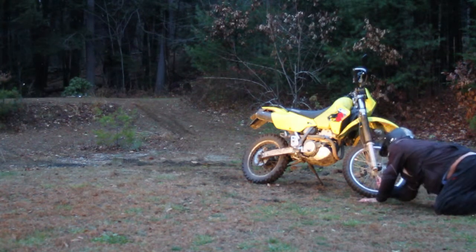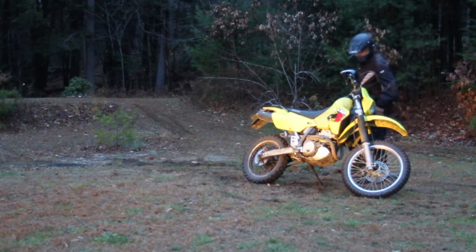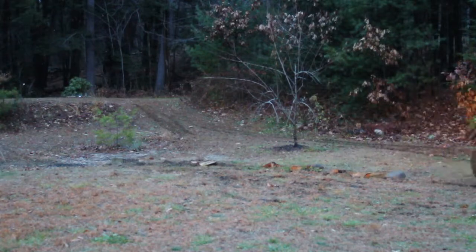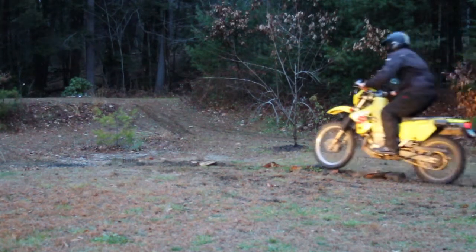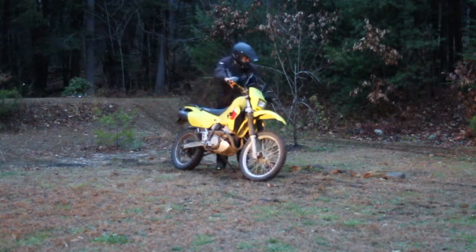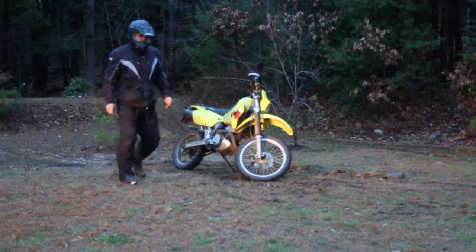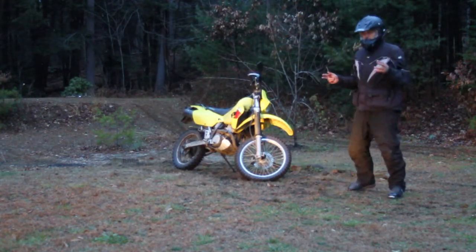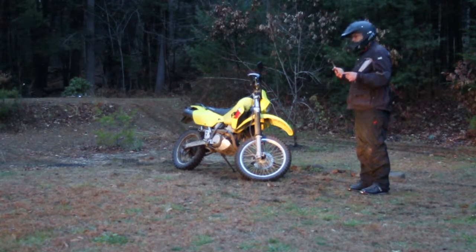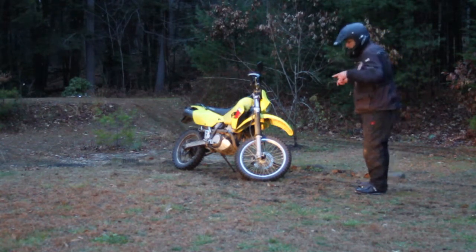Anyhow, now we go to 5 clicks out. So 1/3 compression damping, 1/2 preload. Felt pretty good. I don't know how that looked, but that felt really decent to me. It felt probably the best comfort out of any of the runs so far, and close to the best control. Those are the two elements I'm striving to bring together, comfort and control. Comfort was good on this one. Control was a little off. The front was trying to steer a little bit towards the end. Hard to keep me in a straight line, so I want to try and bring those close together.